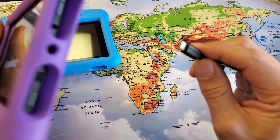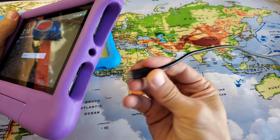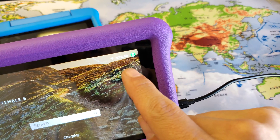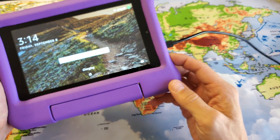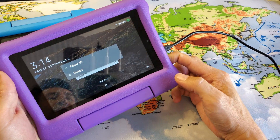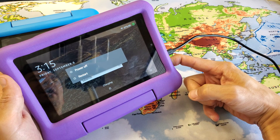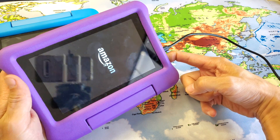So I'm gonna plug this in right here and give it some juice — basically just let it charge. Now we can see on here that it is currently charging. So now that it's charging, the only thing you got to do is just press and hold the power button. I'm not gonna let go until the Amazon logo just appears. I'm still holding on. Not sure why it works this way when it's actually plugged in — it should work the same. Anyways, I'm still holding on to the power button. There we go.